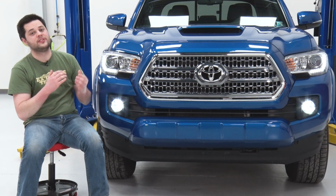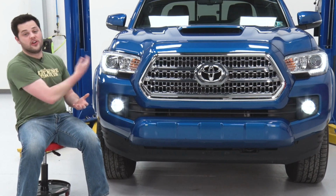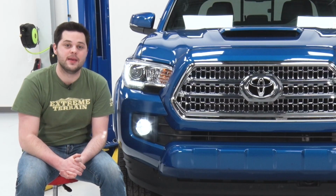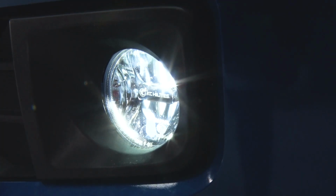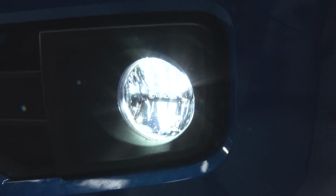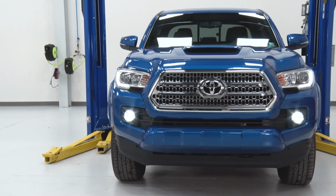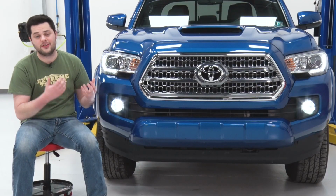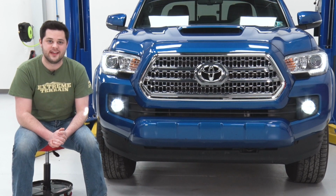They come in at a color temperature of around 5000 K, which as you can see, matches our running light almost perfectly. On top of that, these are boasting a beam distance of around 245 meters. The housing is made out of a lightweight magnesium, which is great for venting out heat on these LEDs. They also feature a polycarbonate lens, which is going to be extremely shatter resistant, so these can definitely take an impact. And behind that lens, we also have a little bit of the KC branding.